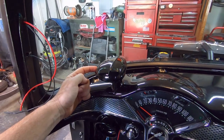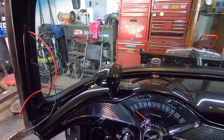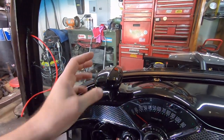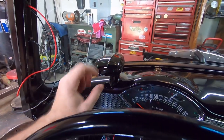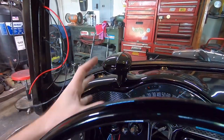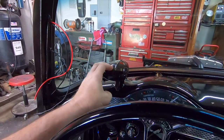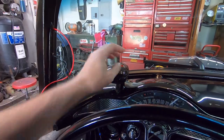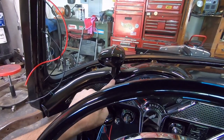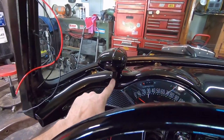This is an Autotronic Eye — this was an option you could get in 55 on your car. I could not find one for a Chevrolet on eBay; all I found was for a Cadillac. I bought it because the head here is two pieces and it screws together to the base — technically three pieces when you take it apart. The head is the same exact part number as the Chevy, so this is correct for the car. The base was for a Cadillac and didn't contour the dash, so I ended up having to make my own mount.